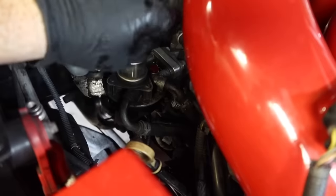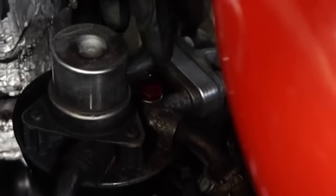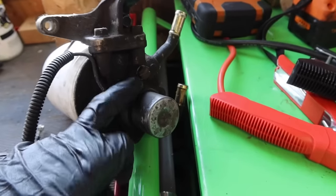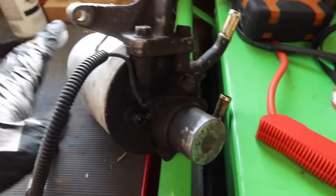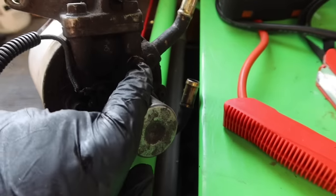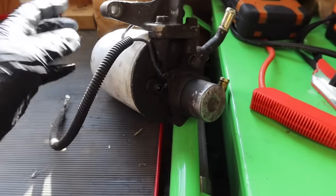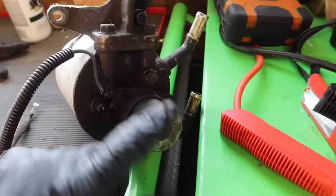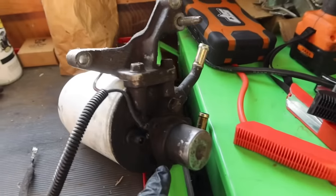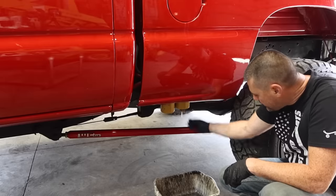I don't have a factory fuel filter anymore — I put a cap over it because I have a lift pump. I have a billet bleeder screw right here in red; I also have them in blue — check out my website, I sell those. The reason I do that is because the factory housing comes with a plastic one, and over the years of replacing fuel filters, that'll start to strip on you. I always use a 13-millimeter socket instead of a flathead screwdriver on the plastic. Basically, all you're doing is unscrewing the fuel filter from the housing and putting a new one on with the new O-rings. Go ahead and loosen the screw, prime it until you start seeing fuel come out, tighten it, press it a few more times until it's hard, click the key a few times, and you should be good to go. Now I'm going to go ahead and drain my water separator.